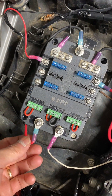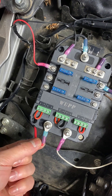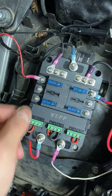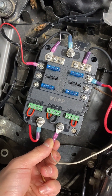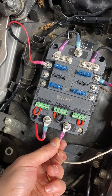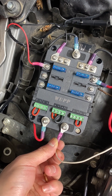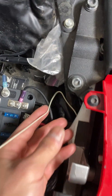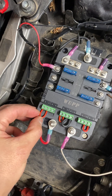I had quite a few problems with this, but this is how I wired it and it works nice now. This is connected directly to the battery, this is connected directly to the battery, and this I tapped into a license plate light — so when the accessories are on, the license plate light is always on. That's how I tapped it in there using a T-tap.